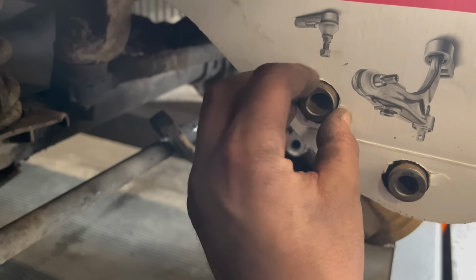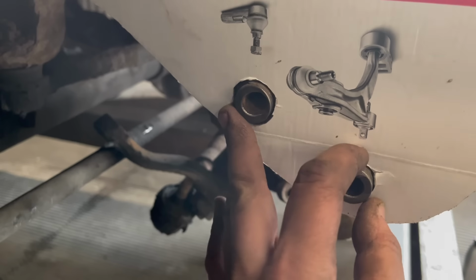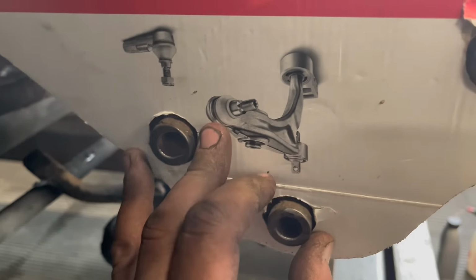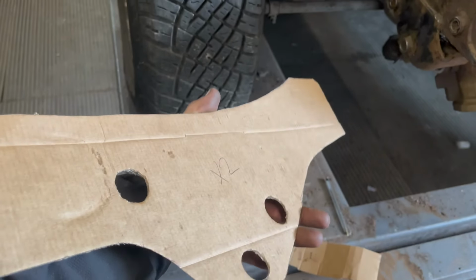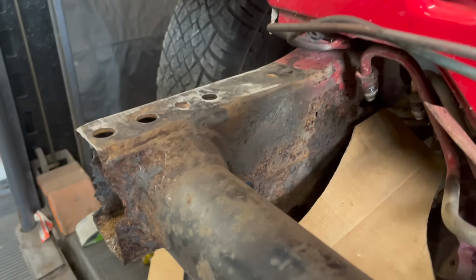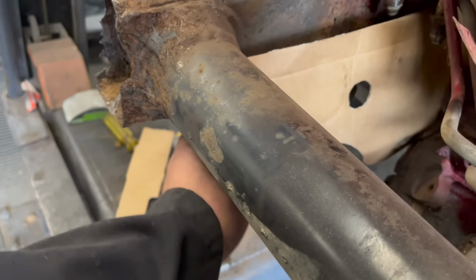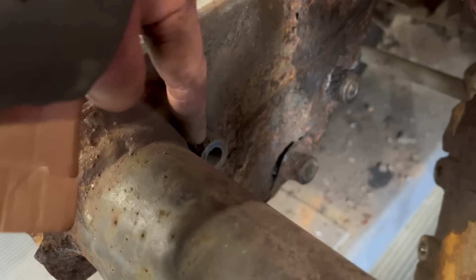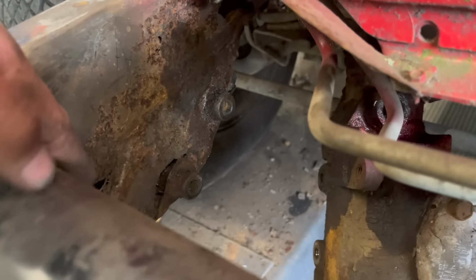And then these, I might just get John to do the holes a little bit bigger in it. No, it doesn't really matter. So I just weld all around there because the nuts sit flat on the top. So we'll weld all that up in there. And then I'll get him to make this times two. I'll just have to cut it back, clean up to get up in there. Same thing again. Them holes line up in there. Cut that back. I'll weld along here, around here where it's solid, you see. Clean that weld there, clean all the loose rust off, clean this.